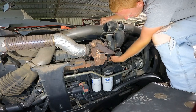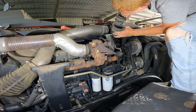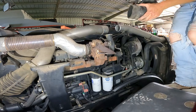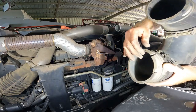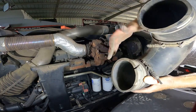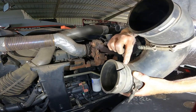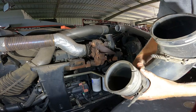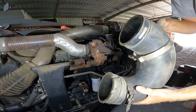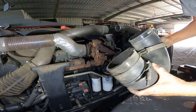At least that's pretty flexible. Oh, no wonder my clamp's holding it up. But I can tell you one thing I don't like the looks of — it's getting cracked out right there. Moving it around I think actually pulled it more. But it's been cracked up to that point for a long time, and the clamp held it down. Now we're cracking on the side there. I think it's going to be time for a new tube, because otherwise that can suck dirt in right there and bypass the air filter. We do not want that — that thing's due for a replacement.